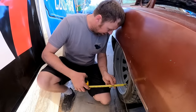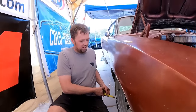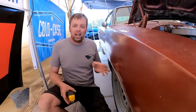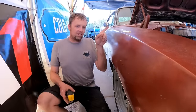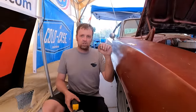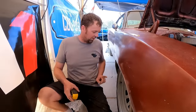This one here, we have 2 3/8. And basically 1 inch. So this side is toed in 1 3/8 compared to the steering wheel being straight. So we're gonna crank out this side a lot. That side, we'll just crank it out just a tick. I mean, just barely. This side here will probably take like two turns of sucking the back in so the front pushes out.